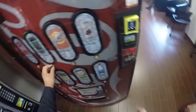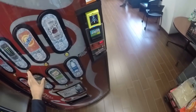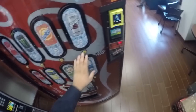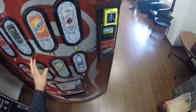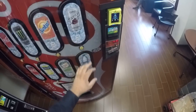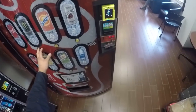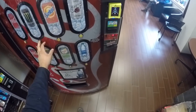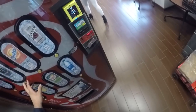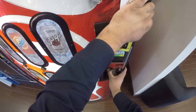I don't know if I've talked about it before, but we've had an ongoing issue with this machine's drop sensor. I'm programming all the prices, SDEP, and all that good stuff right now. But for the longest time we've had a huge issue with the drop sensor, and I think I fixed it today. I found the adjustment — I would kick the machine, and if the light on the board came on, the drop sensor was too sensitive. So I kept kicking the machine and turning the sensitivity down until it wouldn't go off when kicked, then tapped the area where the soda would fall to make sure it still works — and it worked. I really hope we solved the problem.